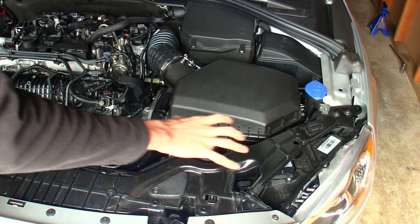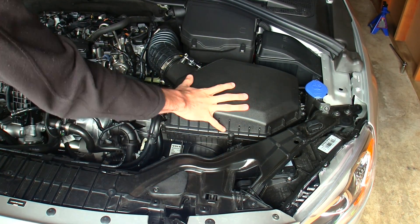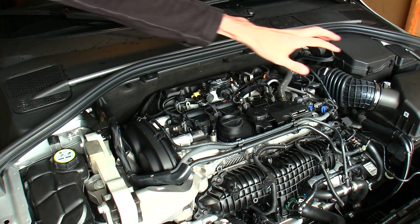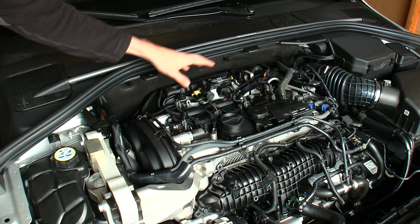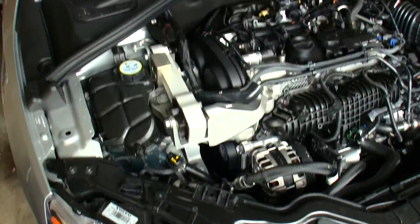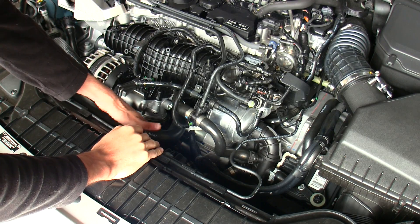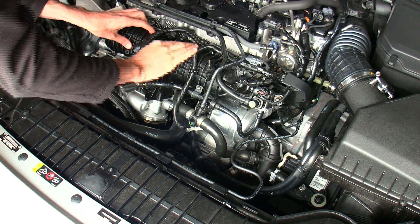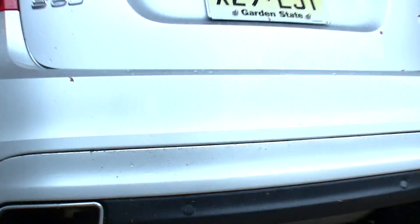Let's follow the intake air. The air comes in up front and feeds back through the air filter. After passing that, it heads through the roots-type supercharger. The air passes into the supercharger up until 3,500 RPM, where it can then bypass and head to the inlet of the turbocharger. After feeding through the turbocharger, the air is sent to the front of the car where it travels through the air-to-air intercooler. It's then routed back through the electronic throttle body into the plastic composite intake manifold and into the engine cylinders. The air exits through the exhaust manifold, travels through the exhaust portion of the turbocharger, and heads through a single pipe towards the rear of the vehicle, joining up with the muffler where the air is split between two tailpipes.